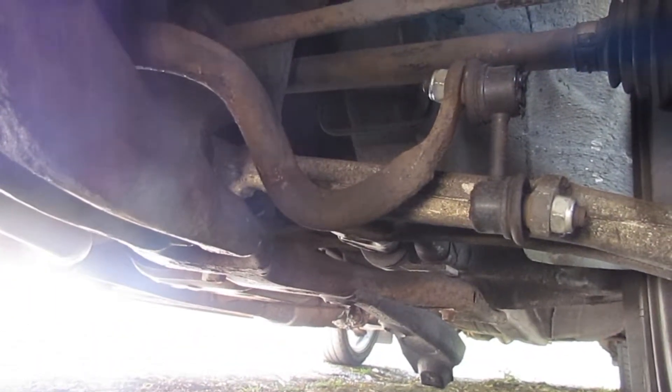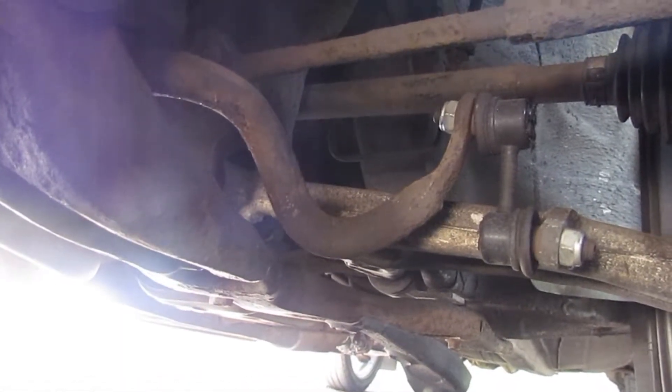One thing I really recommend you guys check is the lower arms. I'm saying this from experience because I don't want this to happen to you — when I got the car home, I was going down the road and the lower arm completely snapped. Those are the steel arms, standard on these. Luckily I was only doing about 10 miles an hour and the wheel caved in and we came to a stop. But I picked this car up from Penrith — if that had happened on the motorway doing 60 or 70 miles an hour, that could have caused a serious accident or probably death.